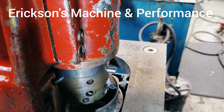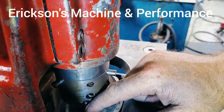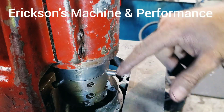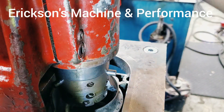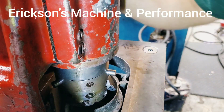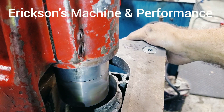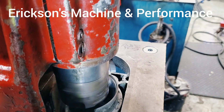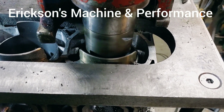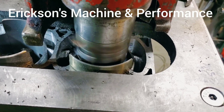We drop the bar down right above the sleeve. This is a ported cylinder, so the sleeve is shorter in the back — it's the way I port my cylinders personally. I also drop the sleeves down, so there's a heavy interrupted cut until you get a good way down the bore. We fire up the boring bar, put it in gear, and bore in low. Then we start boring. These are LA sleeves in this cylinder — it's a nice hard sleeve.